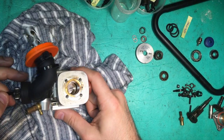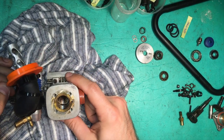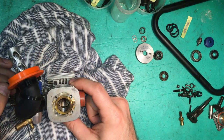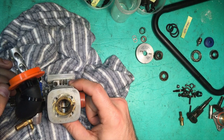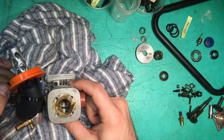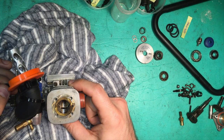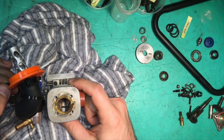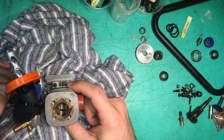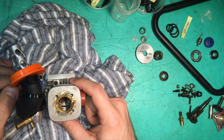So your Hyper 21 is low on compression. Well, it's low in pinch, isn't it? The compression doesn't really change. And when it's low on pinch, then you lose your compression because the air slides down the side between the piston and the sleeve. So we're going to get this repinched.